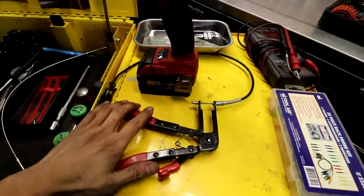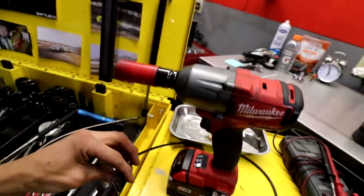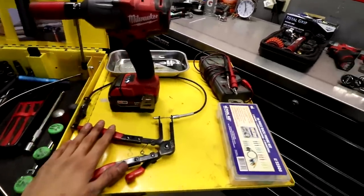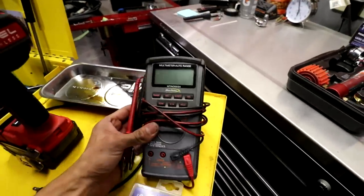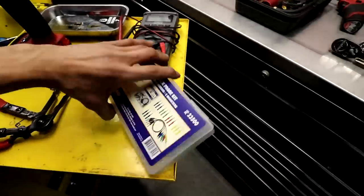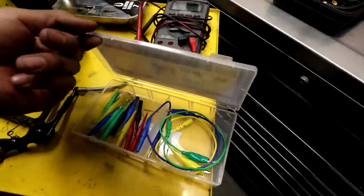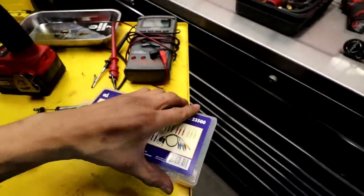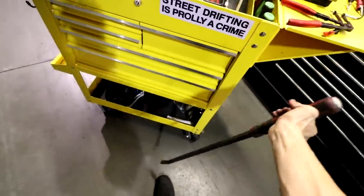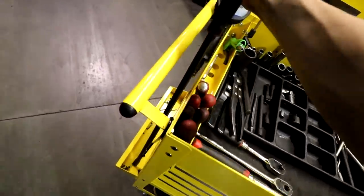A hose clamp plier — I wouldn't say you really need it at first, but it makes life a lot easier if you can't reach whatever hose you're trying to get to, like a radiator hose. I used pliers for the longest time but these are really nice if you can get your hands on a set. Voltmeter — starting off they probably won't give you much electrical diagnosis, but it's still something you're going to need and it's considered an essential in your tool arsenal. These back probe kits are for when you start back-probing and checking wires — very nice to not damage the connectors or the pins, they're super skinny, and give you a good voltage reading or resistance check. Also a big pry bar — recommend getting yourself a nice set of pry bars.